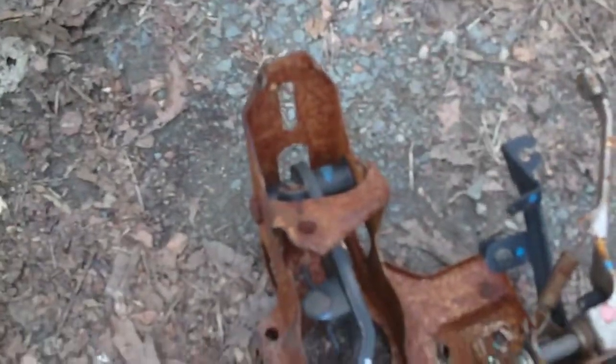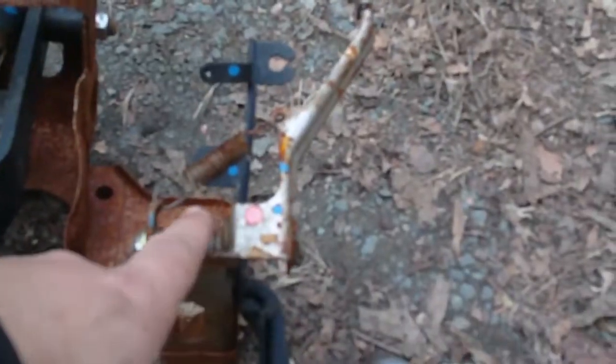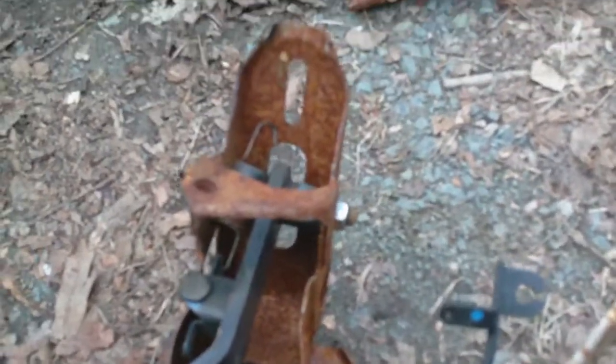And I also got these pedals, which are the pain in the ass. Now the thing with these is, if you're going from auto to manual, you don't want to use the automatic accelerator pedal. Pretty much what you're going to do is remove this spring from your brake, remove that, take this bolt out — you'll probably need an impact, it's probably been impacted on. Take that off and you'll have to remove your automatic brake pedal and put the manual one in place of that. Then you'll add your clutch pedal, which is a completely separate piece. You gotta take all them bolts out — there's four bolts that hold all this in.